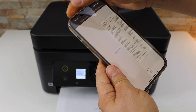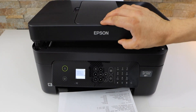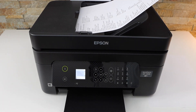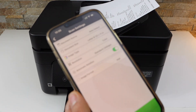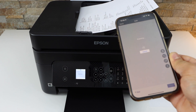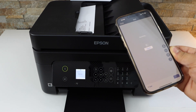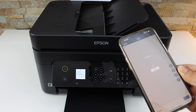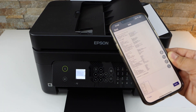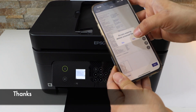Next is to do the scanning. Go back to the main screen and you will see the scan option. For scanning, you can use the flatbed scanner or the automatic document feeder (ADF) tray. I'm going to use the ADF tray — place the document here and click the scan button. Change the settings if you want and click start. It will automatically start the scanning process. This is a very good printer for office use because it also has fax, and it works great for home use too with a really good price. You can then save or share the scanned document. This completes the full setup of the printer for wireless printing and scanning.